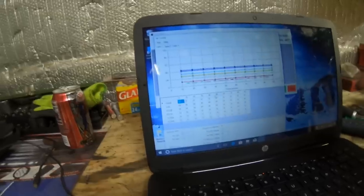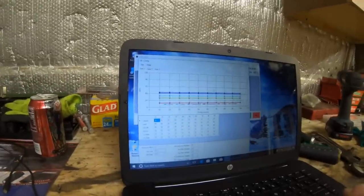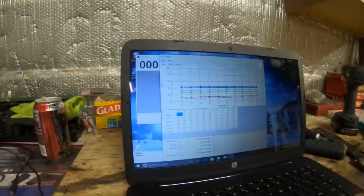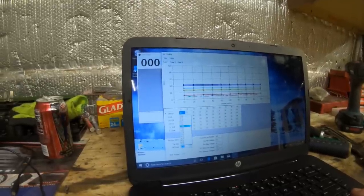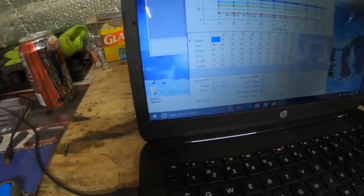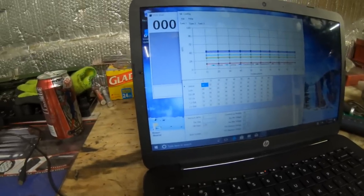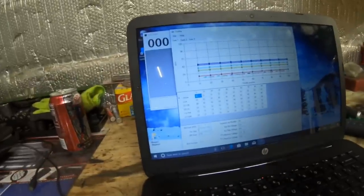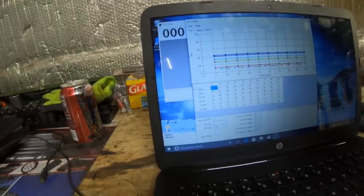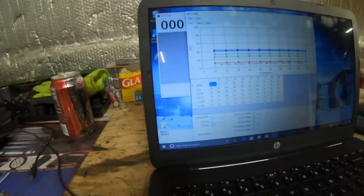Earlier today, it was on the 26 inch drag radials, and that's what we've been driving it on. So right now I'm going to write a new tune for this tire size because the tire size is wrong. What size are those tires, Bailey? 285/60. I'll have to use the calculator because I don't know. With no tread. Okay. So I'll write this new tune here and we'll flash it into the truck with the right tire size. And then I already have the other one saved. So whenever we get to the track, we'll just bring the laptop and we'll be able to just switch it